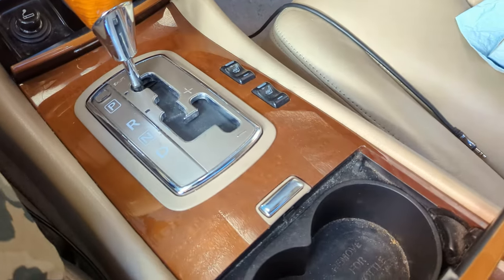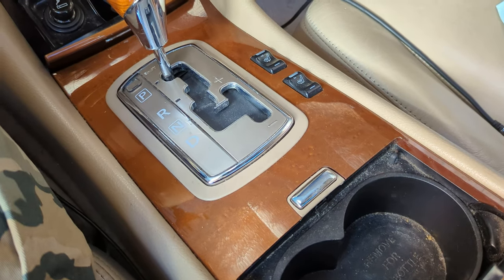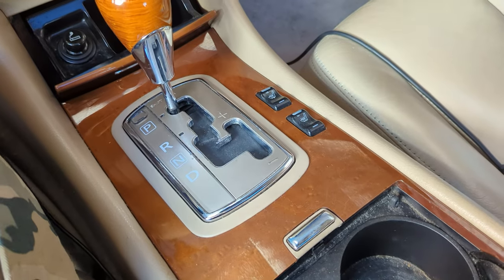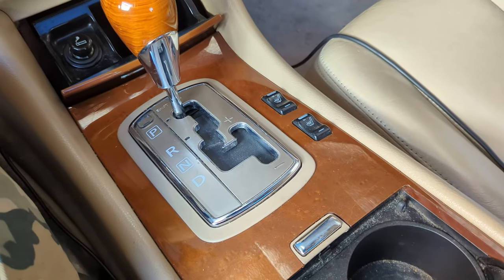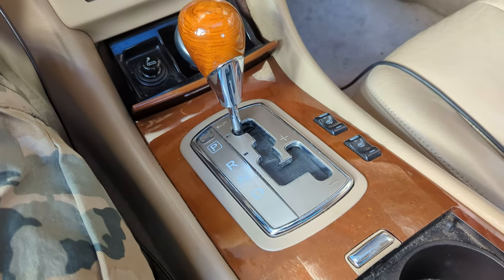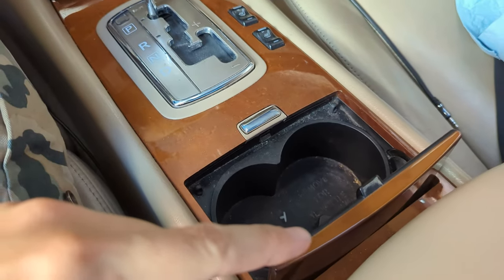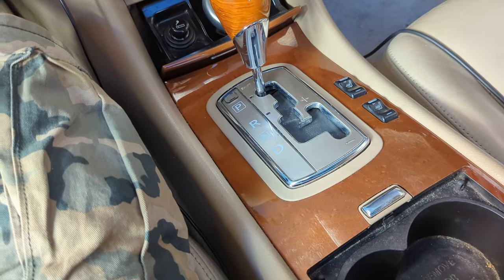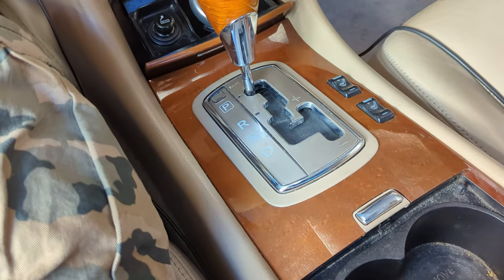So this is really just an experiment. A lot of the information I was going off was from the G35 and 350Z world, and there are some differences — I haven't done a whole lot of testing. I don't do a lot of thrashing the car other than at the track. In the G35/350Z world they disable the yaw sensor and that allows them to go around corners and really beat on the car without the computers interfering too much.